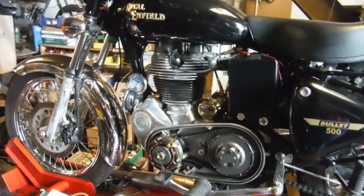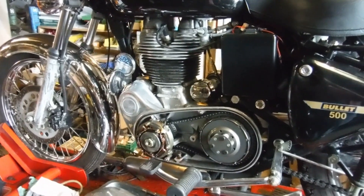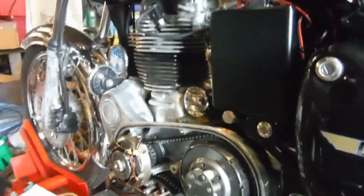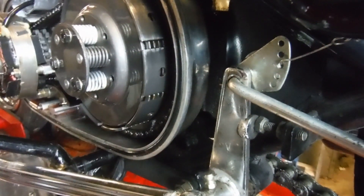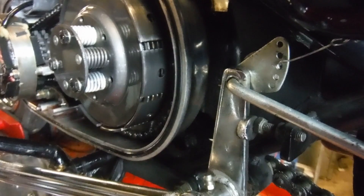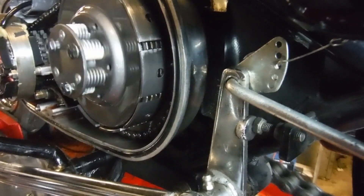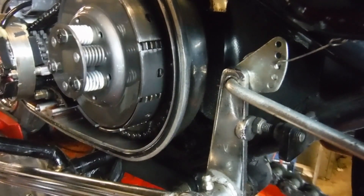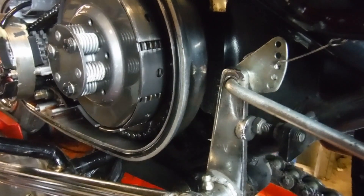Here's a very tidy, low-miles and pretty original Indian Royal Enfield Bullet 500, and it's another one suffering from clutch drag and creating difficulties getting neutral. I've got the machine in gear and I'm going to pull the clutch in and spin the rear wheel. We can see there's a hell of a throw on the clutch pressure plate when it's lifted — it's fluctuating by a couple of millimeters of lift from one extreme to the other.